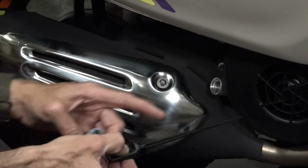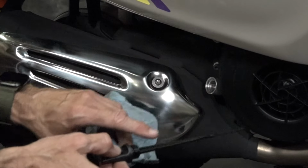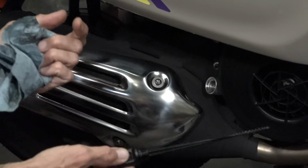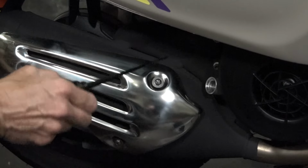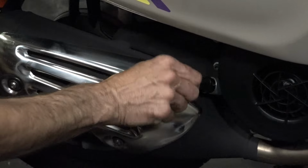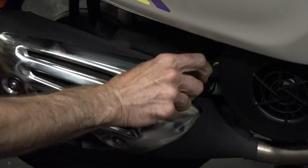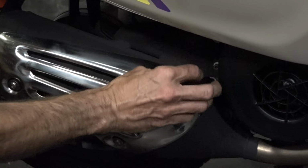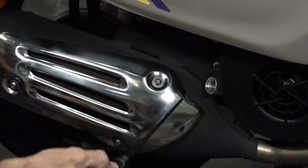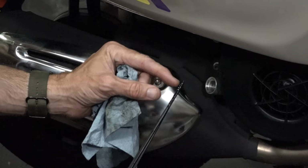If the motor is hot, it's going to read a little higher, and you kind of want to let everything settle so the oil ends up in the oil pan, but the oil expands a little bit as it gets hot, so it might read a little higher than normal. So go ahead and put the dipstick back in, thread it almost all the way in, right where the O-ring stops, and back out. And you can see the oil level right there, above 3/4 of this.